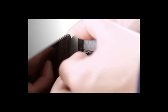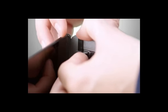If the button does not move at all or moves but doesn't click, refer to the service guide to replace the Touch ID shim. If the click is correct, place the computer on its edge and reattach the alignment tool. Gently hold the alignment tool in place and position the edge guide over the tab so it's flush with the edge of the top case.